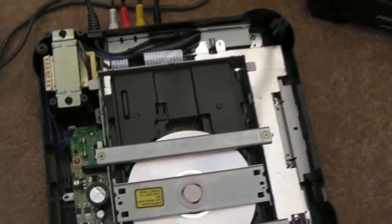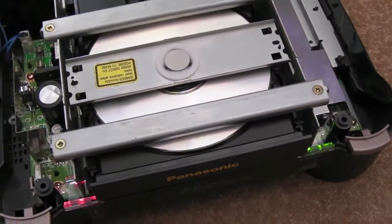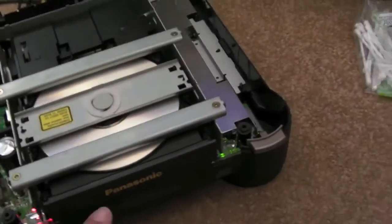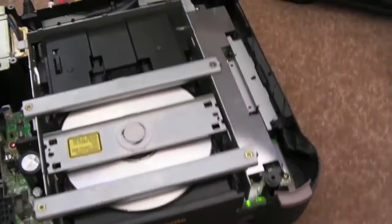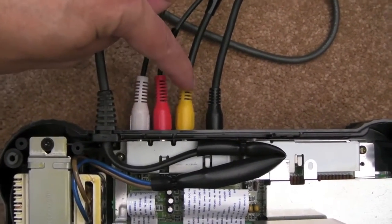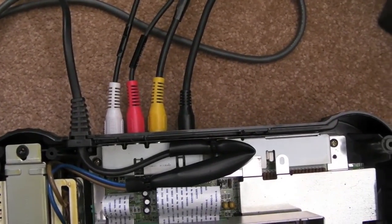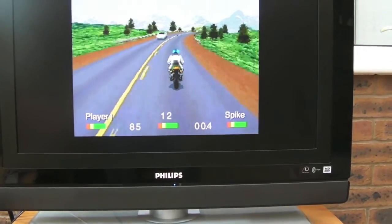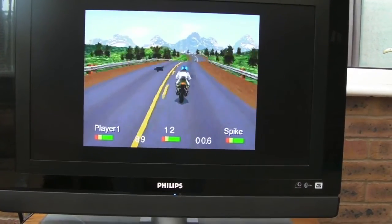I'll reassemble it now and show you the end result. There we go — you can see that's working again, pretty sweet. These things, if you're not aware, I'll post some links to Wikipedia so you can have a look. They were designed and the design was licensed to various manufacturers — there's a Panasonic one and a couple of other makes. One nice feature is it's got phono jacks on the back for composite left-right audio, but you've also got S-Video. I just happened to have a cable from an Amiga from a car boot sale. Anyway, you can expect a follow-up video to this. Just listen to that crackling sound — it's probably going to be capacitors, or maybe something wrong with an op-amp, but most likely caps. Thanks for watching, see you soon.